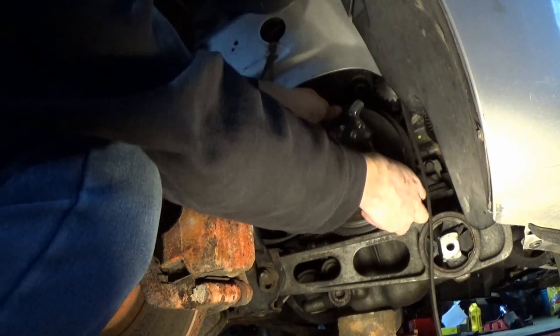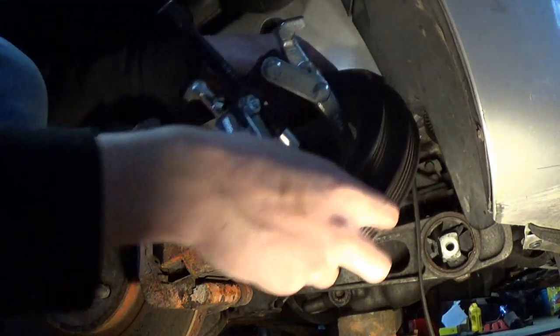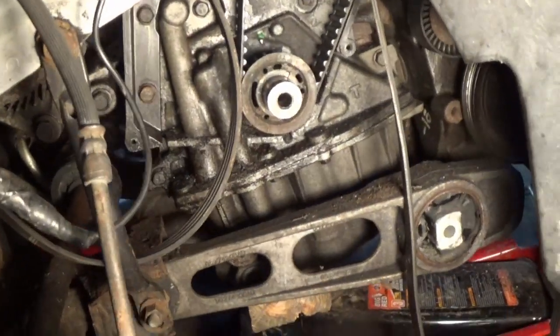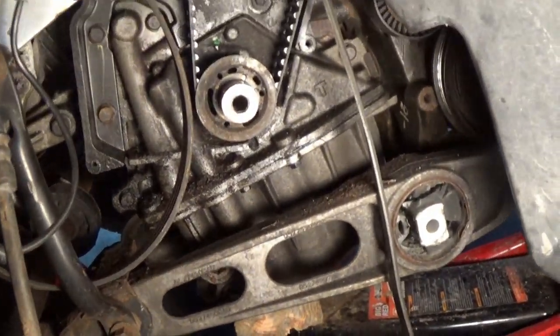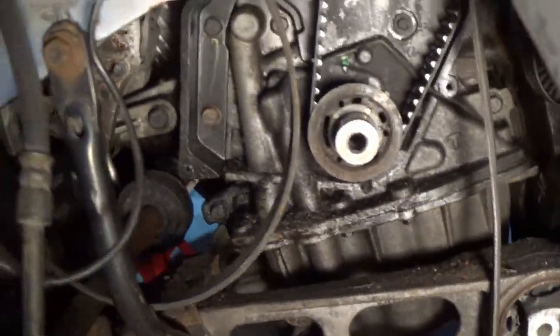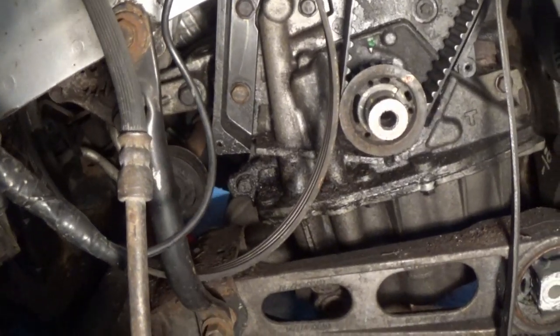Completely out, and so was our pulley. That actually worked really well. And with that out of the way, our lower timing cover is also already out of the way as well. Normally we'd have to remove that, but now we can see our timing, and we can also see that our timing is off. According to that, we might actually not be perfectly lined up top. Are we? Oh, why is my light dying? Yeah, it's out of time up top. It needs to go around another turn or two.